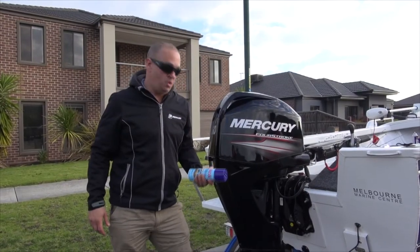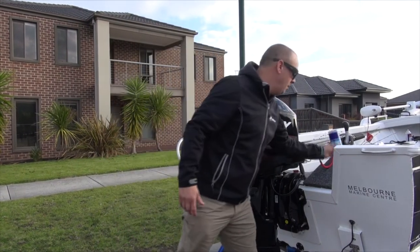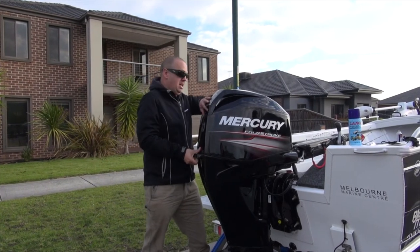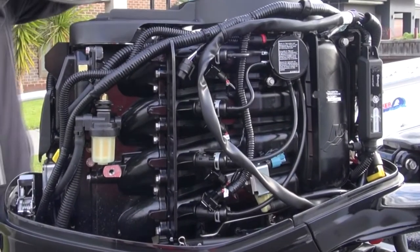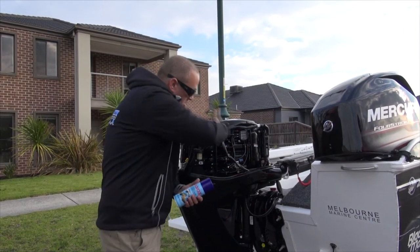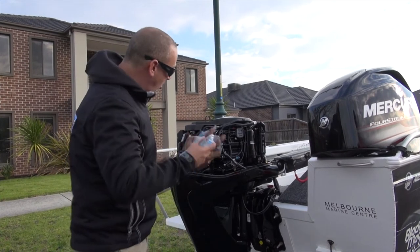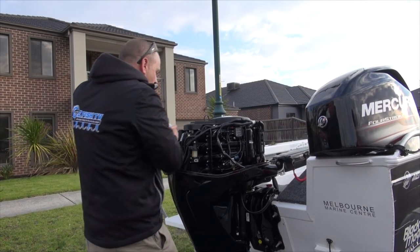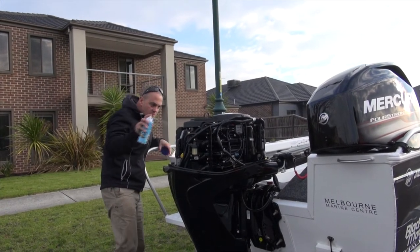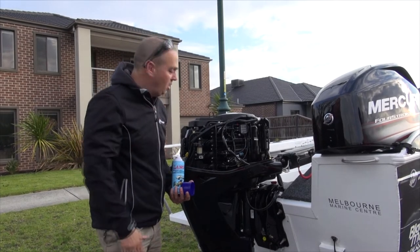Another little tip we have is the use of lanox to keep the salt air and the mist and fine salt water out of your motor. The motor's got a good cowling, so all you're going to do is just lift your cowling up. We're using the lanox, which is a lanolin-based water dispersant, just to give a very, very gentle coating over the motor. When you take the lid off you don't need the fine mist applicator — just give it a bit of a shake and mist over it. That gives you a good coating, just keeps some marine air out and gives you a good coating over your motor parts.